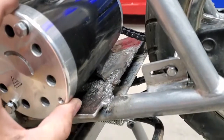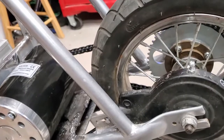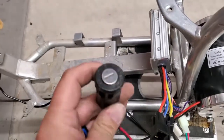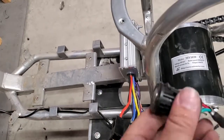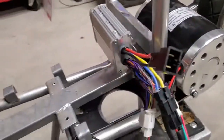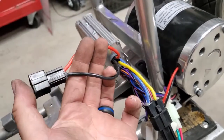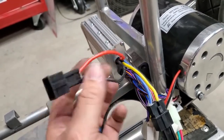Motors here with the welds, everything looks good. I turned it on with a 40-volt battery and it only worked for like two seconds, then it shuts off because it's not enough power to power the controller. Right here is your key switch — my key's on my actual workbench right now. I'm thinking of mounting it in the plastic right here. Here's the controller — it comes with it. This right here goes to the battery. It's a 48-volt battery, or you can put four 12-volt batteries together, which is what I'm going to do. This goes to the actual motor itself and then to the key switch.